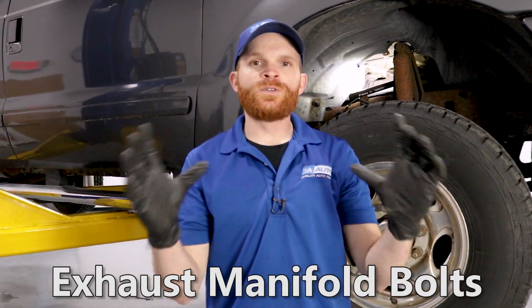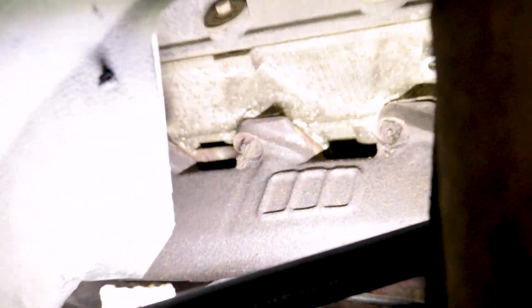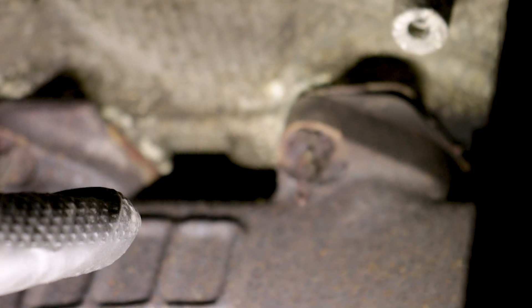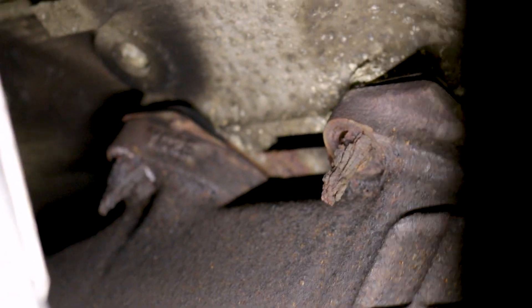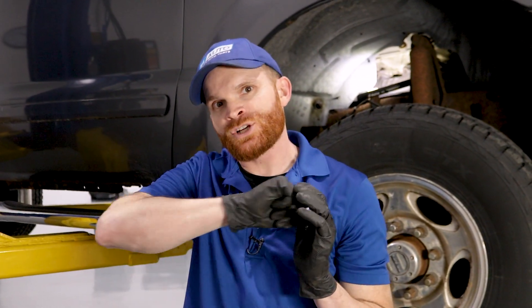For our third problem, we're gonna move to the sides of the truck — right inside the wheel well — where you can find the manifolds. When talking about manifolds, the particular issue comes down to the mounting hardware: the studs that hold the manifolds to the engine itself. As you can tell just by looking at it, the studs are extremely rotted, and the nuts that are supposed to be on there are essentially invisible. If you look closely where the manifold connects onto the engine, you can see some black soot around this one in particular. Any black soot means there's an exhaust leak in that area — the hardware that's supposed to be holding the manifold to the engine isn't really holding it the way it should. All the pressure coming out of your combustion chamber is making its way out through the gap between the manifold and the engine.